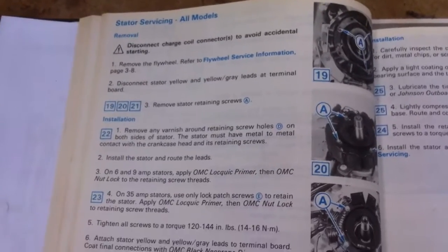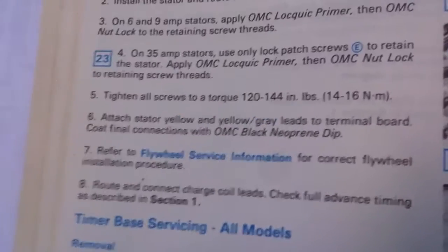This is how you reinstall a stator on a V4, V6 Evinrude — might be for other models too. Make sure you put blue Loctite on the threads on the stator bolts so they don't come out and contact the flywheel if they get loose. Torque them to 120 to 144 inch-pounds, not foot-pounds. Come over here and make sure nothing is going to chafe — no wires are going to chafe on the timer. Before you put the stator back on, make sure these rings put firm pressure down on the plastic ring, but the lips of them cannot contact the timer, or else it'll wear it and it'll stick.